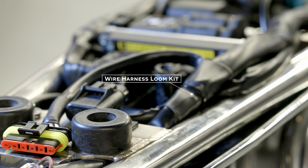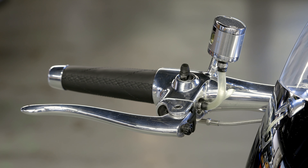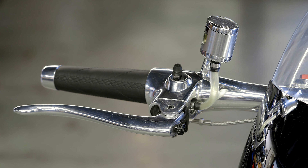Also packaged in here next to our horn we have a hydraulic brake switch to run our brake lights. The options were to have one mounted on the master cylinder, but we're trying to keep the handlebars as clean as possible and didn't want it on the front caliper either. So we built a manifold that nests inside the frame, with a custom brake line running from the master to the manifold where the hydraulic brake switch lives, and then from that manifold down to the caliper.